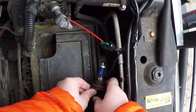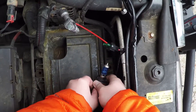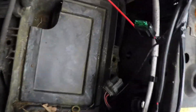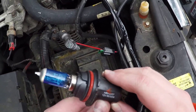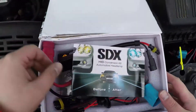They used two different headlights, whoever had the car last. I got the Jeep about a year and two months ago from a kind of shady guy in Chicago. They used different headlights, so it looks like this locking ring needs to be lubed up too. I got it to at least pivot — the lube worked. This one is an HB5 9007 — they bought the wrong headlight. The one on the driver's side was correct; the one on the passenger side was not correct. Somebody did not know how to maintain a Jeep or a car in general.